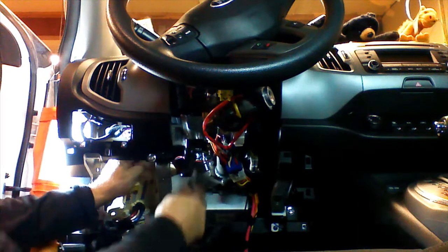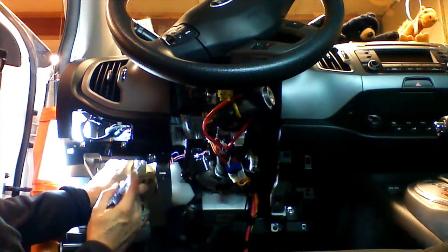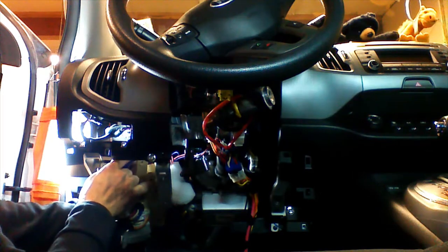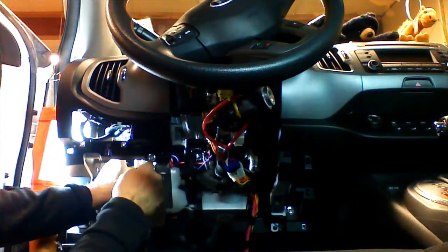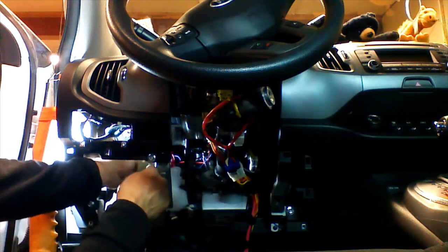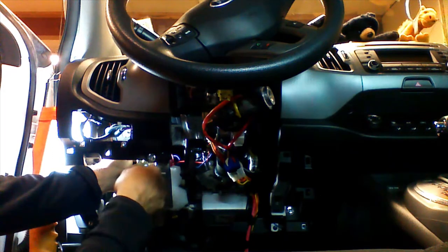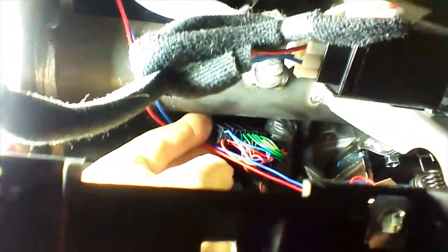The best way to access the wires is to come back around here. We're going to remove a little bit of tape — just about an inch and a half — to get that tape out of the way so we can reach around and access the wires. With the tape out of the way, we can get the wires farther back away from the plug, which will make it a little easier to make the connection. I've isolated the two wires — they are on the end pins of the plug, opposite each other on the top and bottom row.